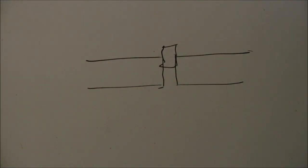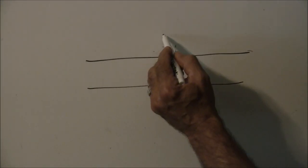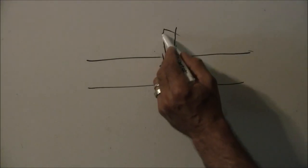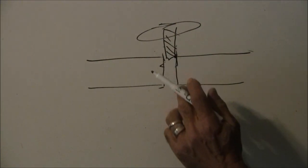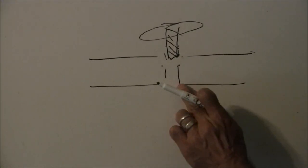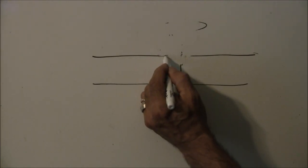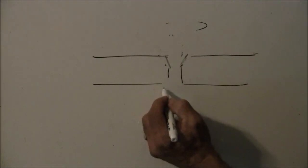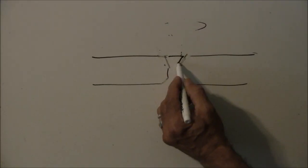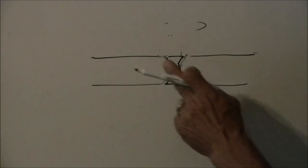So what I do is take a drill bit and move it around so that I end up with chamfered edges. Let me draw this out real quick. What this does is when you patch that hole, the patch is locked in there mechanically. But in my opinion that's still not enough, because the next step is to grind the edge down and lay in a couple of layers of fiberglass over that.